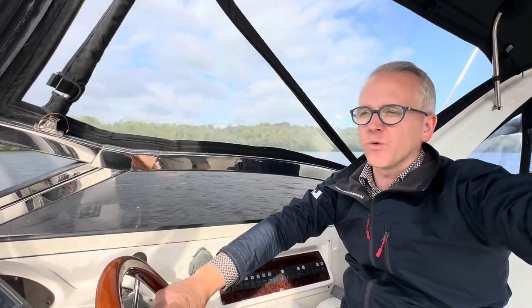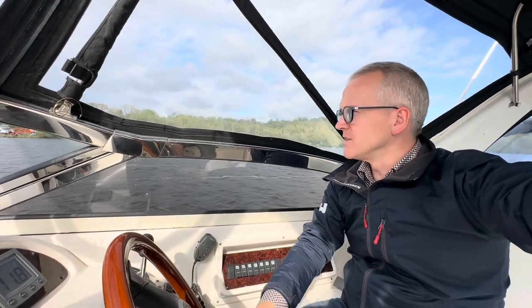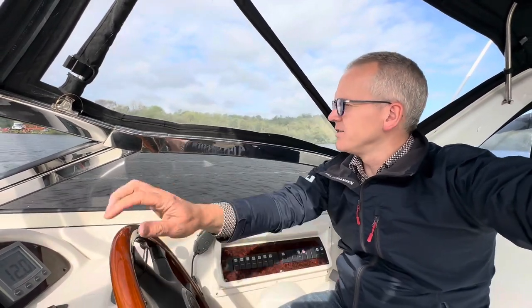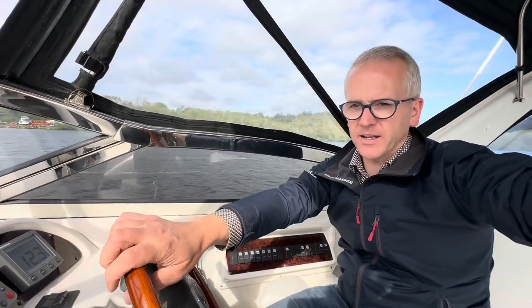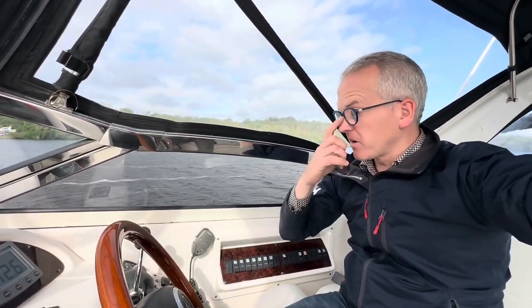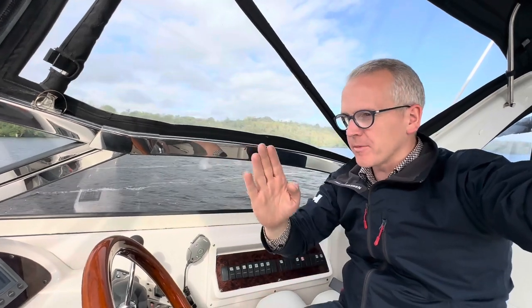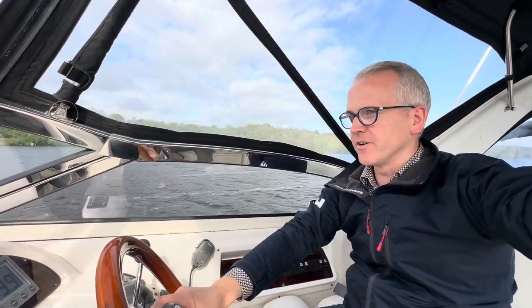So it's going to cruise anywhere around like 20. The comfortable sort of economical cruising speed is going to be something like 21 knots whenever you're planing, and 6 knots whenever you're just tooling around on the rivers through the Shannon system. If you're thinking about taking it down that neck of the woods, everything's working here, which is really good. The controls are good. It literally hasn't missed a beat. Whenever you do the pull on each single engine, they're both coming up to exactly 3,000 RPM. This boat has passed every test that I normally do.